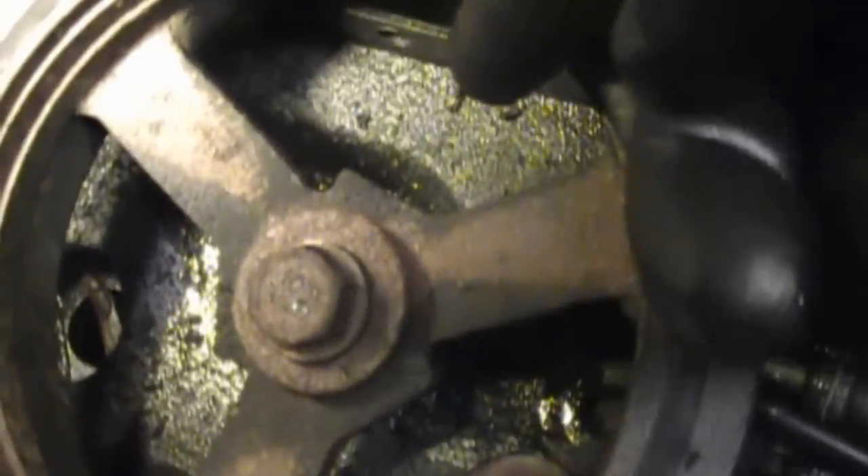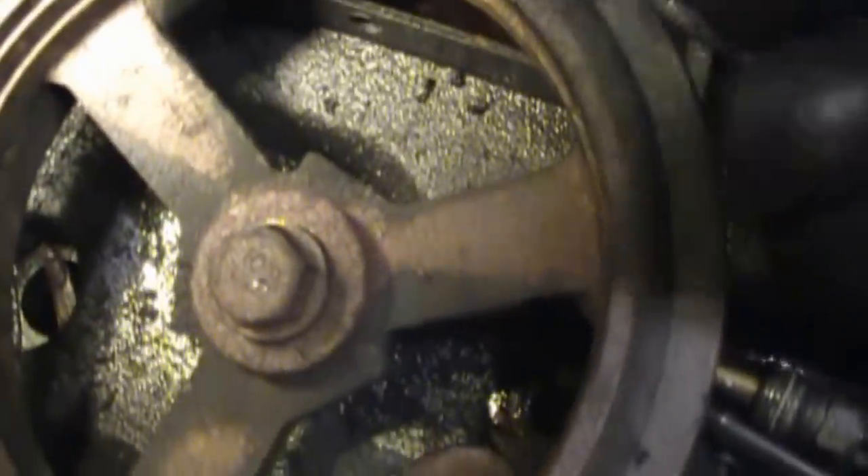To get that harmonic balancer off - you see those little places on the flywheel, those little cut places? It's not a square. You can get a set of three-jaw claw pullers and hook your claws under there and that will pull it right off. It takes a little patience, but once you get that off you're good to go. Here are my jaw pullers - that's what I use.